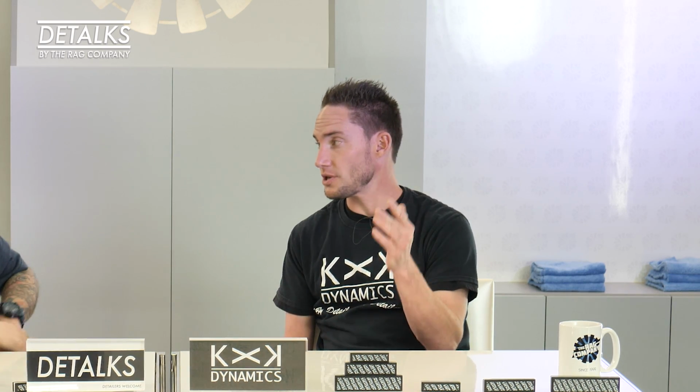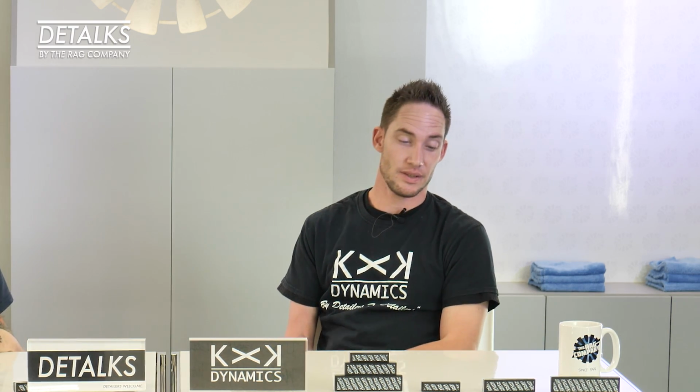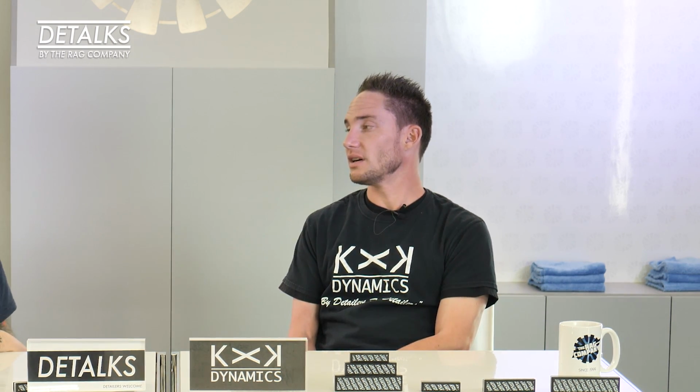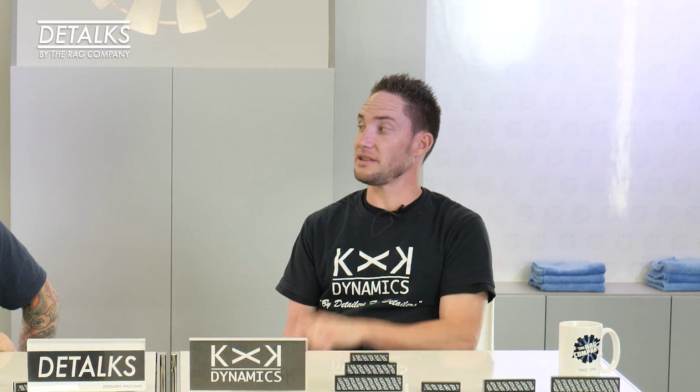I have headphones in and I'm working away. Do pay attention. You've got to pay attention to exactly what that block is doing, the sound it makes, how it feels on the surface. If something doesn't seem right, it's probably not right, so just stop. Clean the surface off and check it. If there's something wrong, then don't sand. If you're unsure about your skills or what's going on, call someone. A phone call is quick, and a respray on a panel is expensive. Just be cautious and use the thing between your ears.